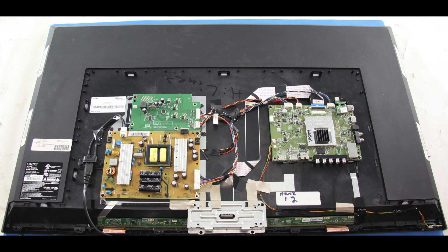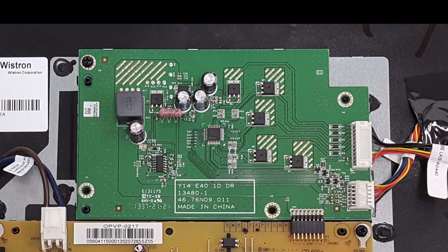I have begun by removing the screws and the back cover off my TV. We will be running the test on the LED driver board, as that is the board that has the connection for the power to the LEDs in the panel. We have highlighted this board in the video. Here is the cable connection that runs from the power supply to the LEDs — I will be checking the voltages at this connection.